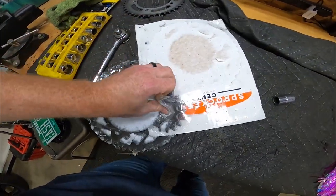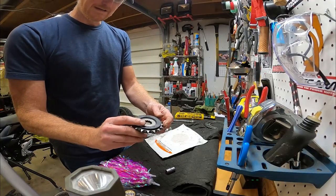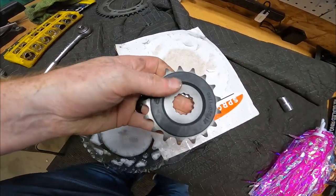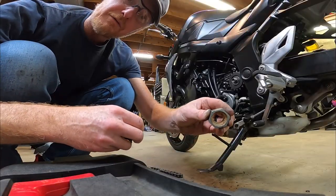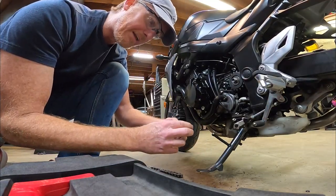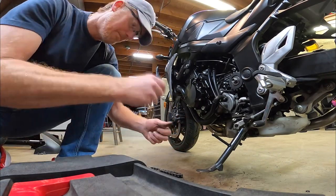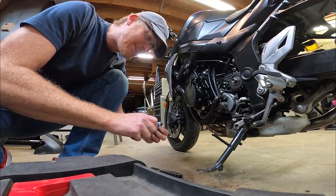Now let's put on the new front sprocket. It's nice and heavy, and this is just like the factory — same teeth, front and rear. And this has the dampener. I absolutely believe in the dampener. Any inline four needs all the help it can to avoid vibration. So I'm going to clean that really good and put a little new threadlocker on it. This threadlocker blue is called medium strength. I'm just going to put a little on it to make me sleep a little bit better — just enough to give it a little extra security.